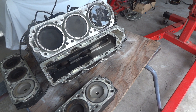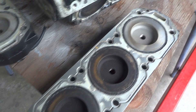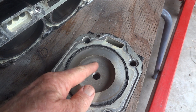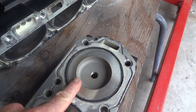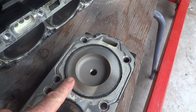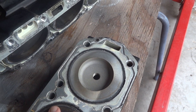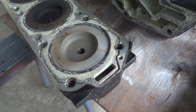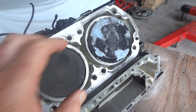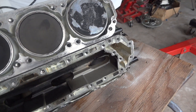The plot thickens. The reason I thought this thing was detonated is because you've got two black chambers and one clean one. That rough surface which I thought was eroded due to detonation - the squish area is absolutely still got machining marks in it and is scrupulously clean. So I don't think it's detonated at all - that's just the rough surface from the original sand casting. The exhaust ports are really clean too, indicating that it's had some water in there. Both front cylinders have got this steam-cleaned look. Although the piston's a bit rattly in the bore, the brand new piston's the same, so there's nothing wrong with that.